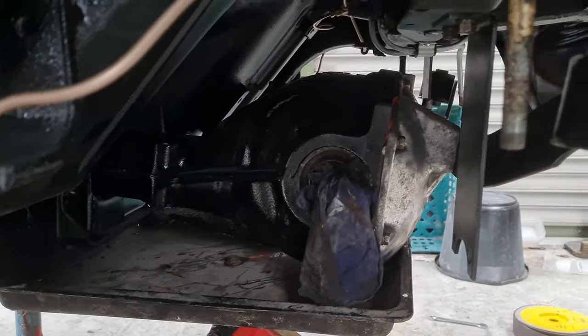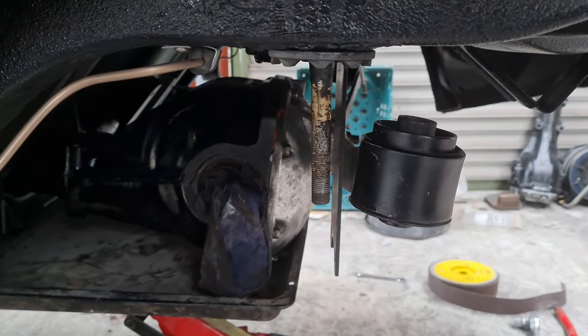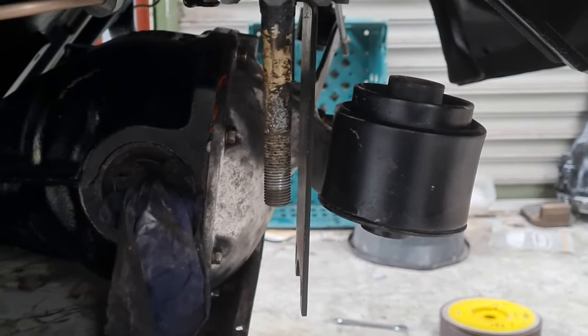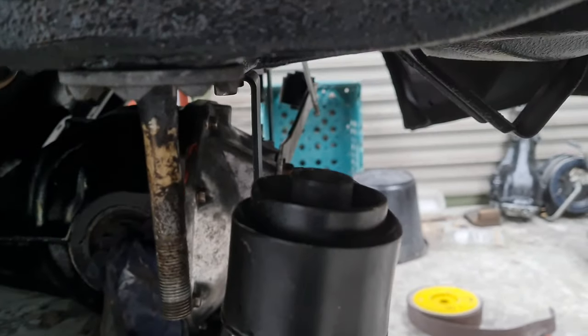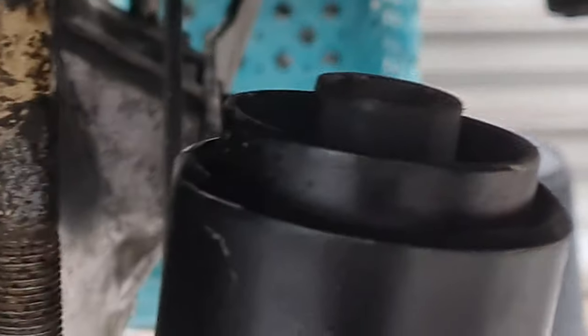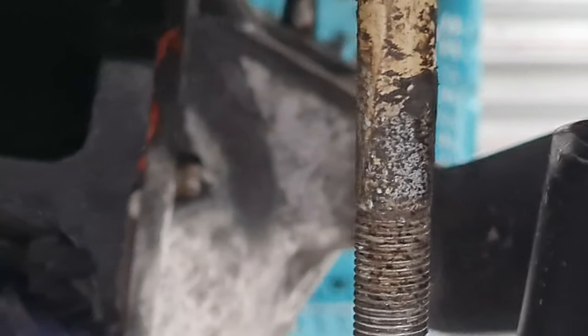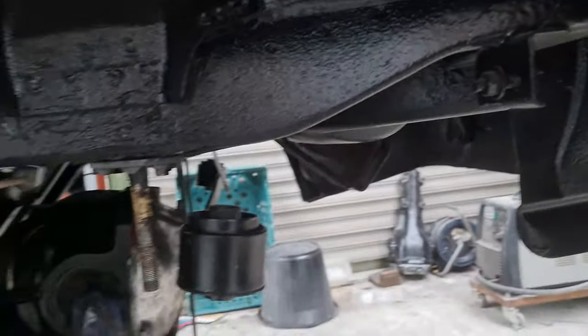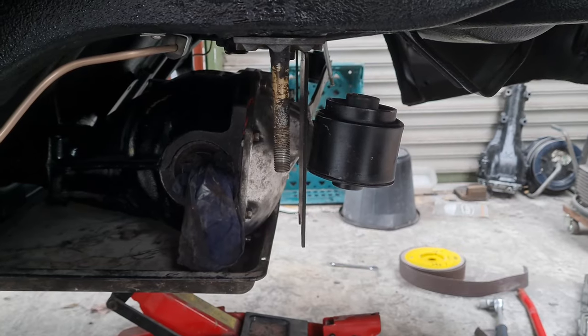The diff is lifted up into place and I have reversed the angle on this cross member — we've got a couple of issues. It's back further when we flip it over, which makes sense because there's actually a bend on the cross member, the same on this side, which has got to pull it back further than where it's meant to be. So we're going to try and see if we can tweak it forward, see if it's able to get back to reaching around the vertical drops either side. I might try and see if we can catch it into something solid and just give it a little tug to see if we can get this to play ball.